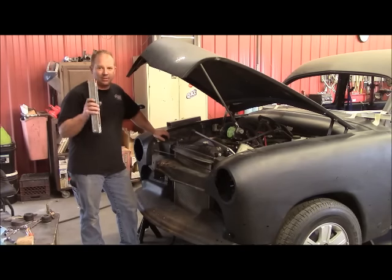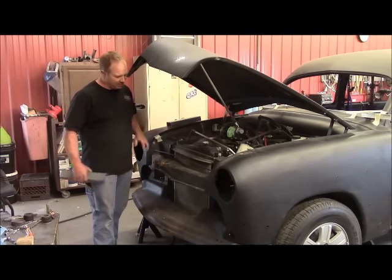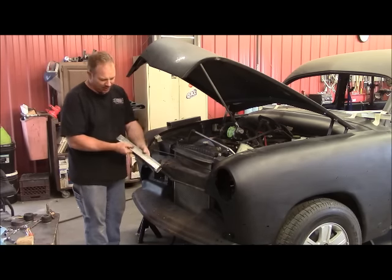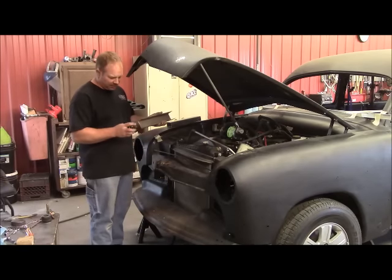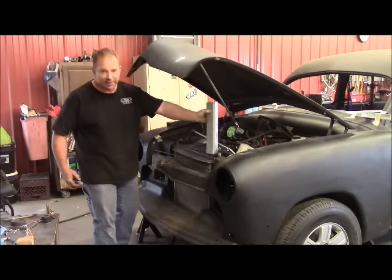Now it's time to start building your front radiator support. The way this was before, I can't use any of the other structure because your radiator is so much bigger. So what I've done is fabricated some posts out of 16 gauge - I've doubled back in here so it's extra thick. I've got some mounts from another build and I'll put a little foot on the bottom and insert this in here.